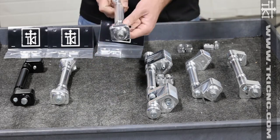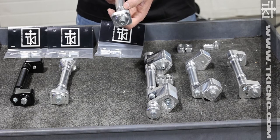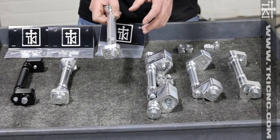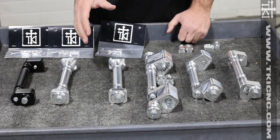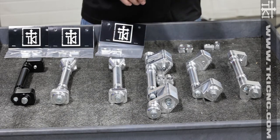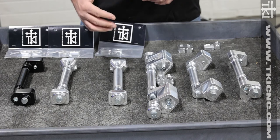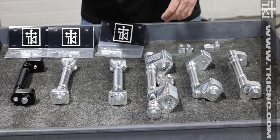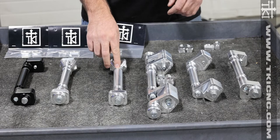With the 20 millimeter straight axle there are also some spacers on the axle shaft. Those spacers change between stock bearing sizes — the 6004 bearings — which are all your stock bearing sizes for Cat dual rail wheels, Ski-Doo, and Polaris. If you buy our billet wheels you take those spacers out, because we run a bigger, more robust, stronger bearing that's a little bit wider.